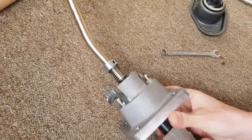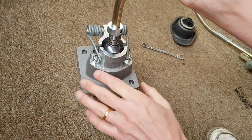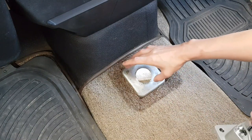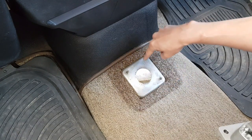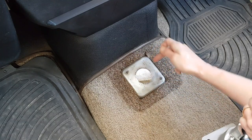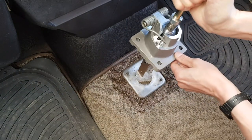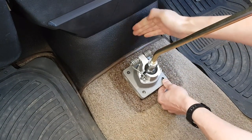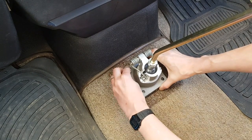So that's in position now - we've got the bend over to the right and then the spring so it'll push down into reverse and spring it back. Now I just need to fit it to the van. I'm going to drill the holes and then attach everything underneath and make the adjustments as well. There are two bolts that we can screw onto here but we also need another two. I'm going to attach it to those and then drill a hole in for the other two, which will allow us to add these in from underneath and have four corners of this plate - a really nice solid attachment.